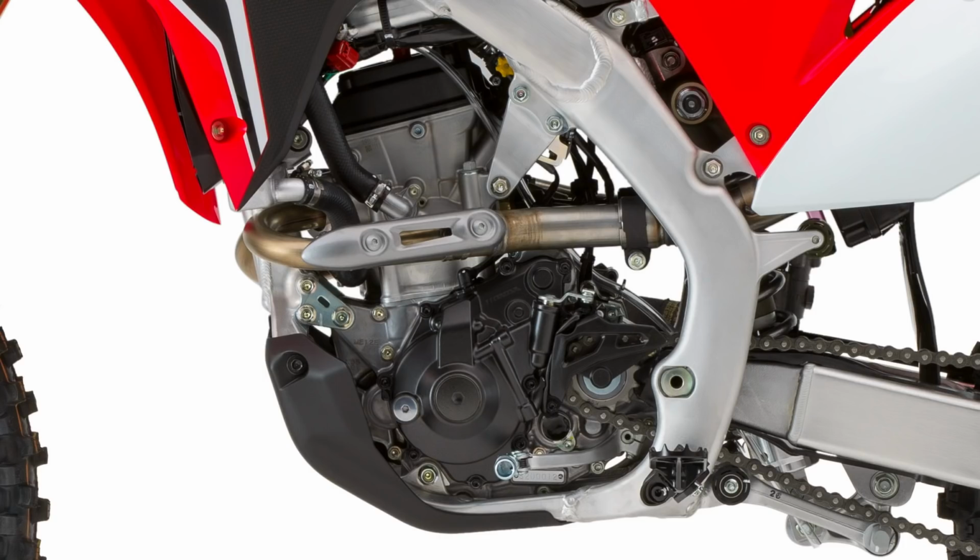It does not gain a torque control system like the 450 did. It still has 3 maps and an HRC launch control. So it has its one mapping switch on the left. That's the kill switch plus the little blue buttons that run the maps, and you can also activate the launch control system from that same one. It also retains the 44 millimeter throttle body, which was added last year. So it's still on the downsized throttle body overall.